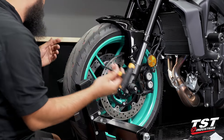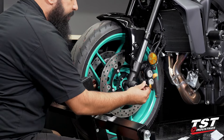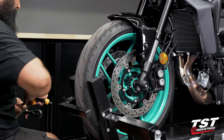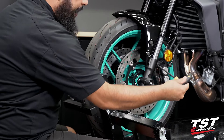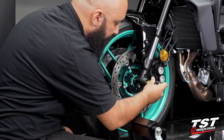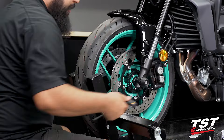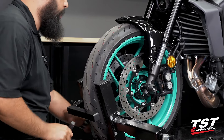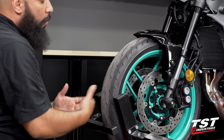Now we can go ahead and grab our 6mm hex keys or hex bits — one on each side — and just snug them up against each other. If you have a hex bit attached to a ratchet or a T-handle to gain some leverage, you really just want to snug them up to prevent them from loosening. If you need torque specs, you can torque them down to 10 foot-pounds — that is a safe torque specification. As long as you bottom them out and do not over-torque, you will not find a situation where they come undone or the assembly breaks.